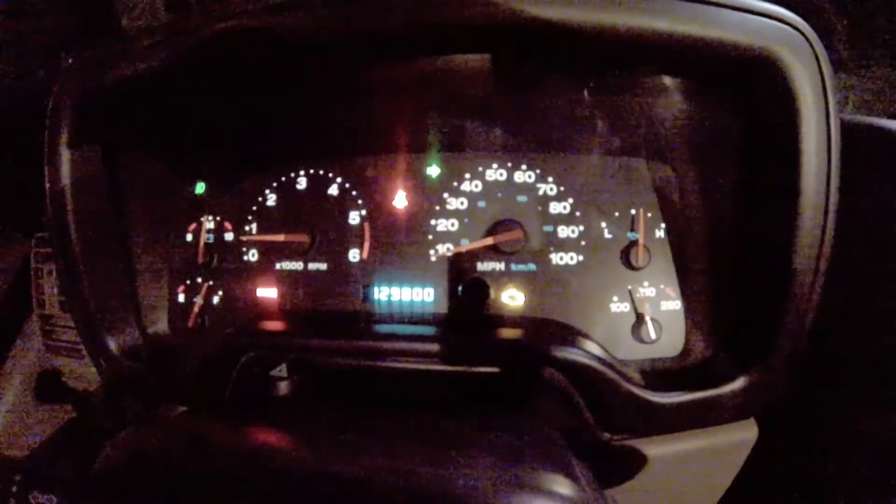I'm feeling a little leery about the TPS - not sure if I couldn't back-probe it properly and that's why I wasn't getting any reading, or if the TPS is actually the problem. So I've got it unhooked right now. The check engine light immediately came on, so I've got a hard code - at least I know the check engine light works.